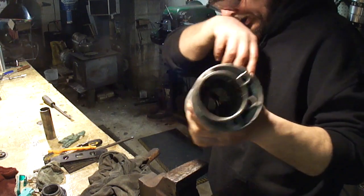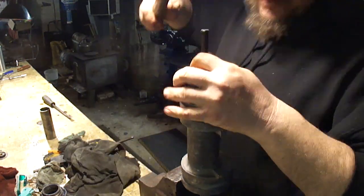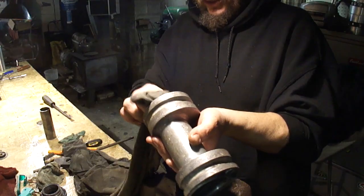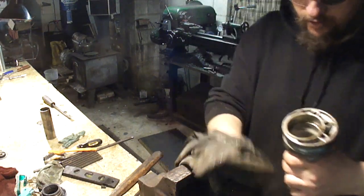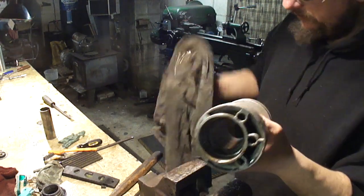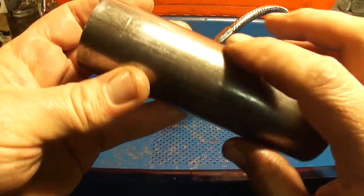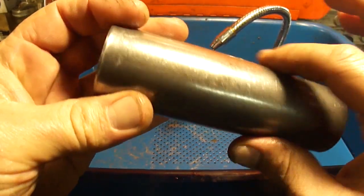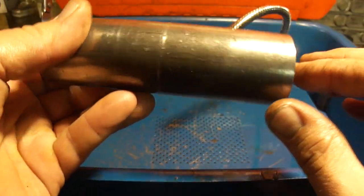There's still a bunch of grease inside, but I'm going to tap this other bearing out. Now that the sleeve's out of the way, you can get in there a lot easier. You're going to want to clean all this grease out — get all this old stuff out of here. Take some brake clean or stick it in your parts washer, do whatever you've got to do to degrease this thing thoroughly. That way, if there's any metal chips that ended up in here, they won't go into your new bearings. There are some sharp metal burrs on this sleeve, so I'm going to knock those off with sandpaper — I don't want any of that coming loose and getting into the new bearings.